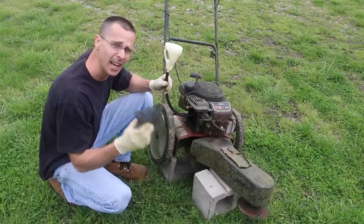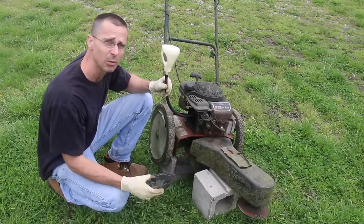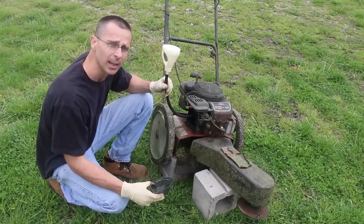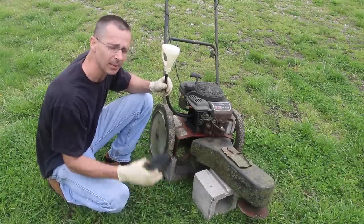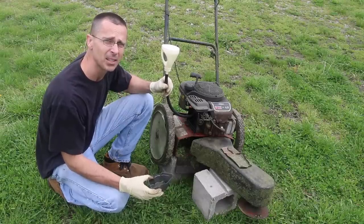I'm going to add eight ounces of Seafoam into the measuring cup — running half the can through the engine. As I'm adding the Seafoam you'll see a lot of smoke. When I get near the end of the measuring cup, when it's just about empty, I'm going to basically stall out the engine and allow it to hot soak for about 15 to 20 minutes.